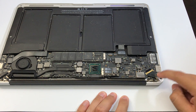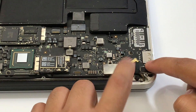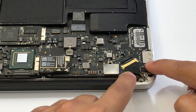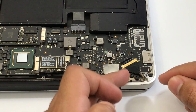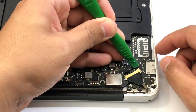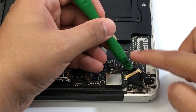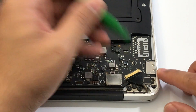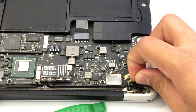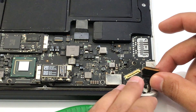The second final thing you can do is disconnect your LCD connection — this is your screen's connection. There's a good chance it's loose or inserted wrong, especially if you dropped the MacBook Air and the connection disconnected slightly. Get underneath the black tab, pull with your fingernails or a tool to snap it up, then grab the connection and pull back until it fully disconnects. Have it disconnected for 30 seconds, then connect it right back again.